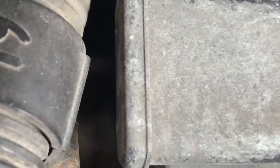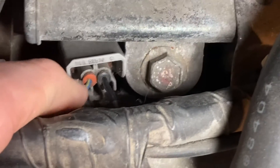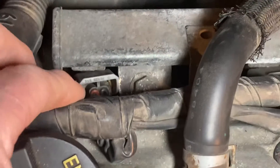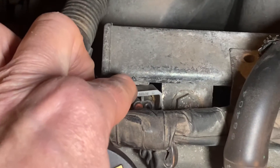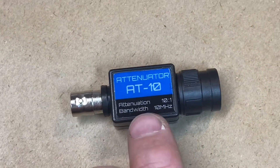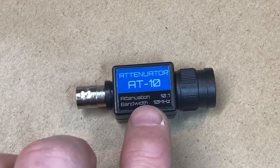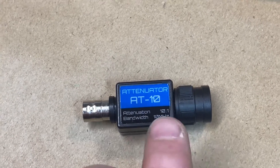The other wire — that is cylinder 1 — the blue with the yellow, that is switched to ground in order to control the injector coil. Keep in mind, although it's a 12-volt feed switched to ground, because it's a coil, like any coil, it's going to have a flyback or an induction kick when the ground is removed via the ECM. This is a high enough voltage to damage your DSO-152. The input voltage is expected on the DSO-152 at 40 volts plus or minus. This could be high enough to damage it, so make sure you use an attenuator. I have a 10x attenuator. As long as you have reasonable attenuation to drop the signal to something the scope can handle, you should be safe. Doing so without an attenuator puts your scope at risk.